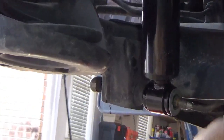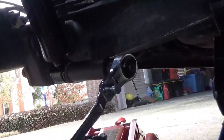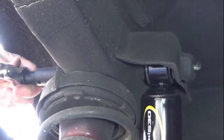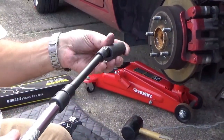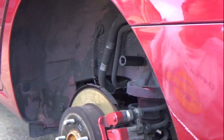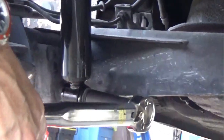Put the washer on first and then the nut. After this, both the top and bottom strut bolts can be tightened using a ratchet. The torque specs for the Forte call out 40 foot-pounds for the top bolt and 80 foot-pounds for the bottom. Always remember that when using a torque wrench, tighten until you hear the click. If you do not hear the sound, you have not reached the proper torque and you need to keep going. Do not jerk the torque wrench or move it quickly — this will cause it to click early, giving you a false indication of torque.